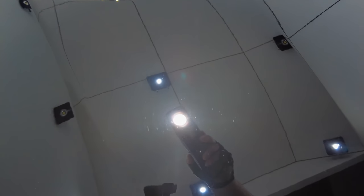Now, as far as defect removal goes, this time I'd say I was able to remove not only the lighter swirls, but also the more moderate ones, maybe getting about 80% total defect removal in this section. However, the random, isolated, deeper scratches or RIDs did still remain, and hopefully you guys can also see quite a bit of haze and micro marring that this combination has created.